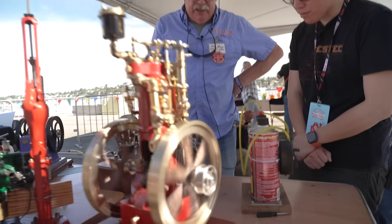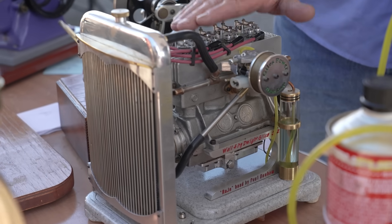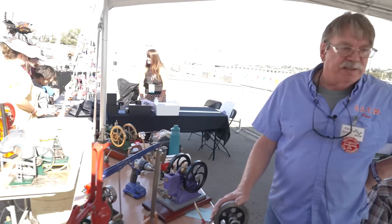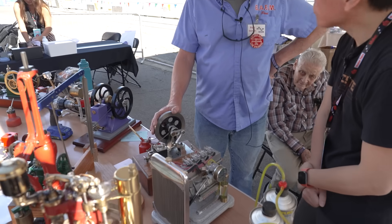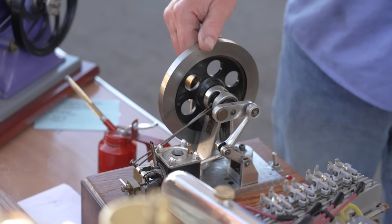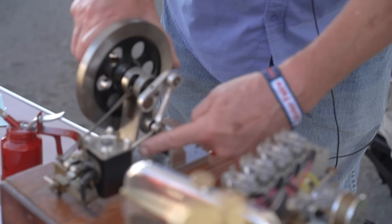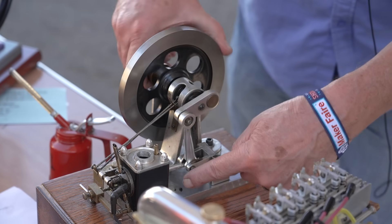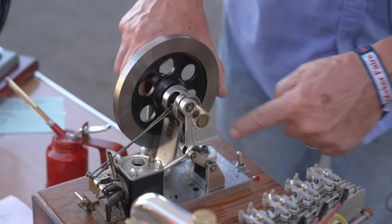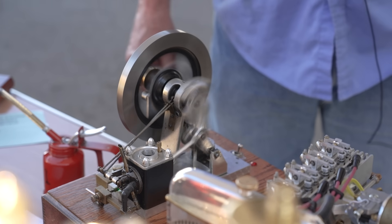This is a Wall Four — internal combustion, very old. They were very popular boat engines for modelers, originally flathead, then they went over to overhead valve. This and this are both Atkinson cycles. It's still an internal combustion engine, but what makes it different is Atkinson was trying to get around the Otto four-cycle patent. If you look at it carefully, the piston goes in and out twice with one revolution of the crankshaft. And also the stroke length is different. The downside is you have all this toggle mechanism you have to make up for. But this is demonstration one — runs like a top.